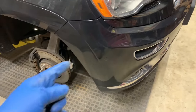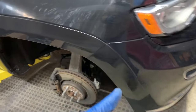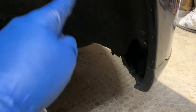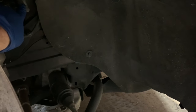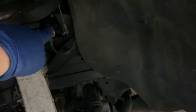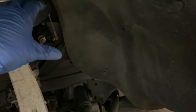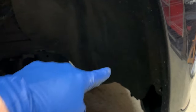The reason I'm working on this side of the vehicle is because the pump is underneath the front section of this bumper. To get to it, we're going to have to take this inner wheel well shield out, and then the pump is right there. If you jack it up you can look underneath and see the pump, but to work on it we need to work on it right here. The other thing in the system is these sensors here which tell the vehicle where the height is. The ones I have are metal and adjustable, so you can adjust your height a little bit without doing it through the program.